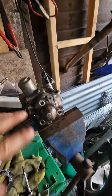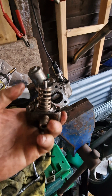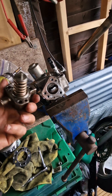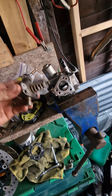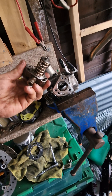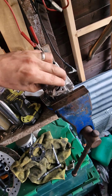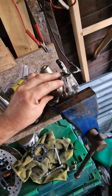The other main problem is this pumping mechanism — the springs. Despite being really, really strong springs, they do break, and when they break it doesn't pump. If it does pump, it's going to pump very little, because it's operated by a cam inside that spins and pushes this to send out the fuel. When that spring breaks, you get little or no fuel flow.